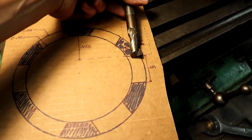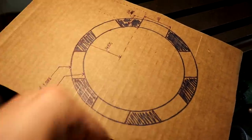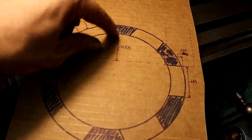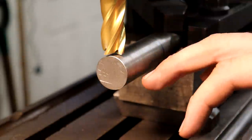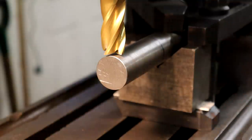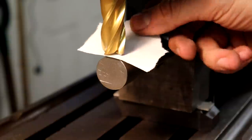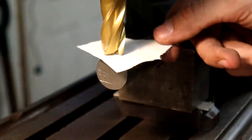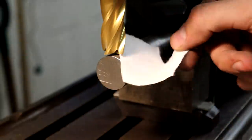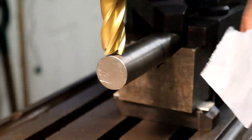After completing one side, I have to take the end mill over to the other side and make the same cut, rotating all the way around. That will have cut both sides of each spline. To actually edge-find the Z and Y directions - if you don't have an edge finder, you can just use a piece of paper. I'll turn the mill on and very gently hold this piece of paper in there while slowly bringing the table up and getting the material closer to the end mill. Once the end mill grabs the paper it'll fling it out, and then I can move it an extra two or three thou - the thickness of the paper - and zero it right there. I'll do that and then do the same thing on the side, and that will have zeroed each direction.